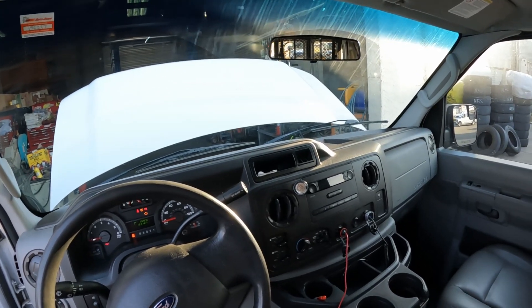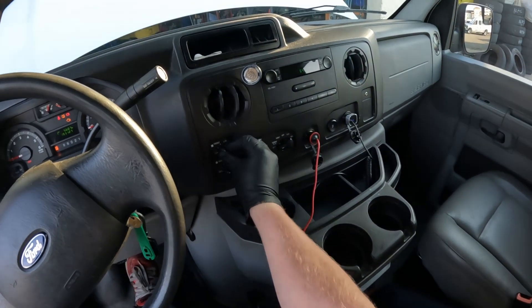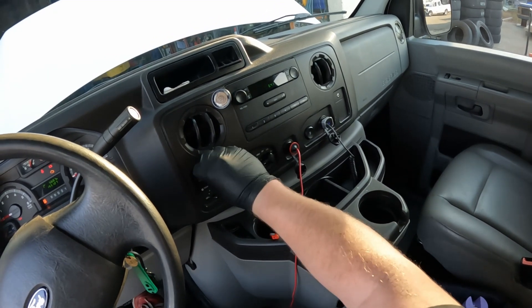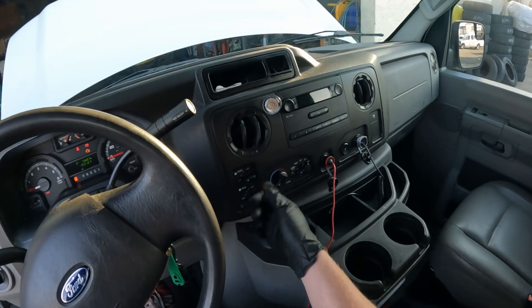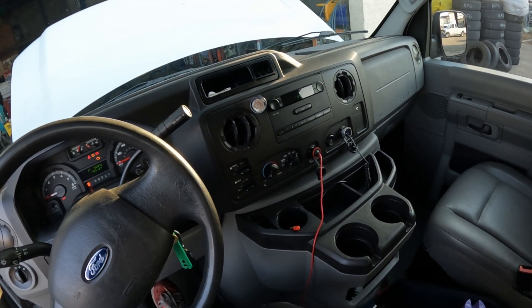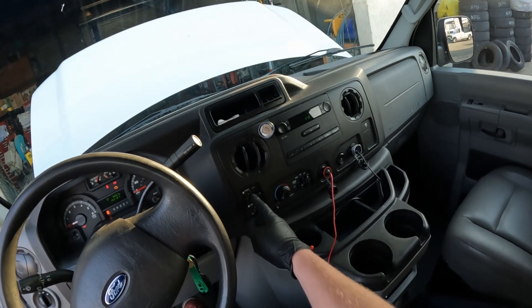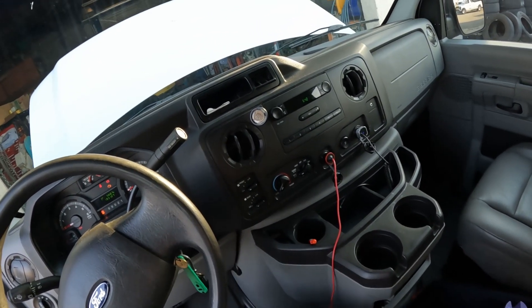What's going on, I'm Grim Repair, welcome to the channel. Today we're working on a van where the blower does not work in any position but high. When I wiggle it around it won't come on, and the switch feels pretty normal — feels like a good switch. A couple causes that would give us this would be a bad switch, bad wiring, or a bad blower motor resistor. It's usually the resistor, especially if the switch feels good and nobody's messed with the wiring.